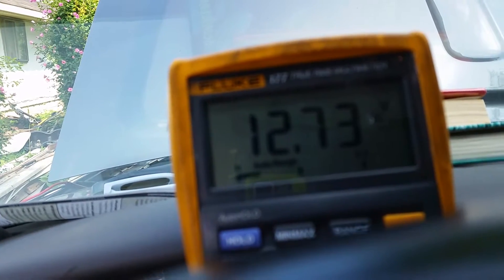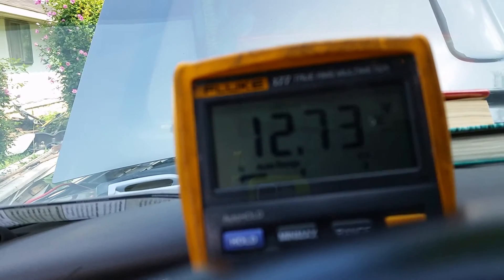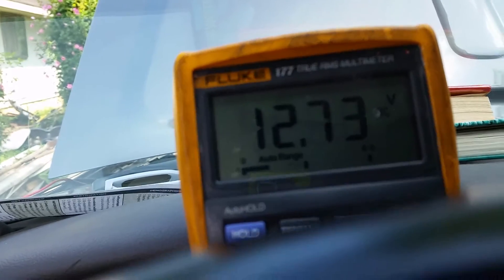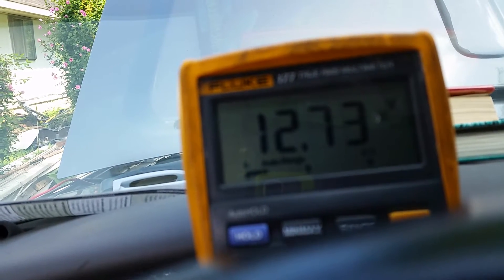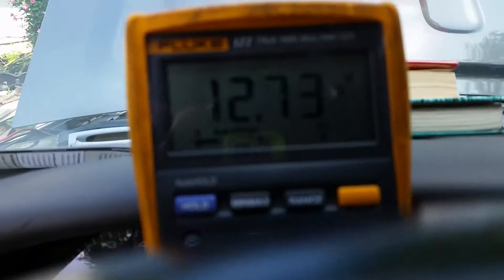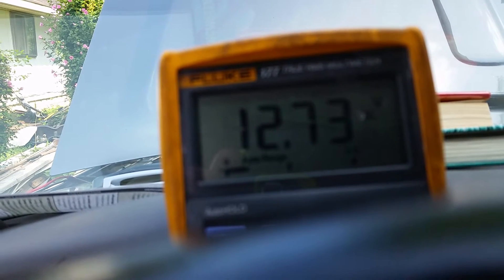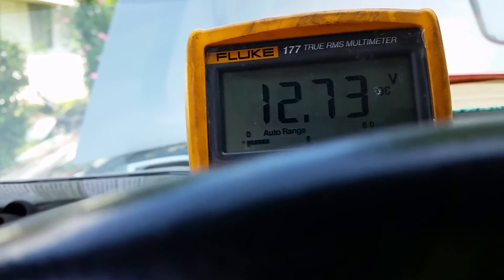After you've got everything disabled and just want to crank the engine over, crank it for about 15 seconds. If the battery voltage doesn't drop below 10 volts — the book says for a load test it shouldn't drop below 9.6 volts, and the battery load tester can put a bit more load on it — but I've been doing these tests in the field for a while. This will give you a ballpark idea of the battery condition and whether or not it's good.